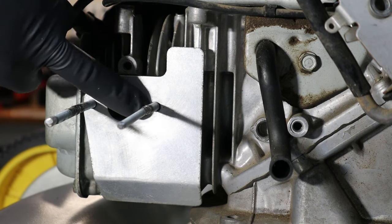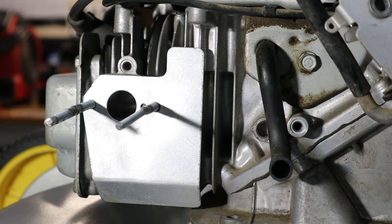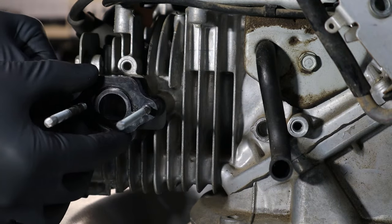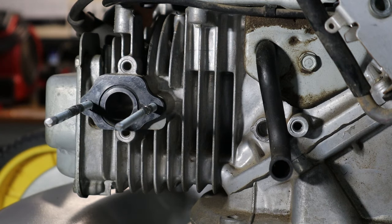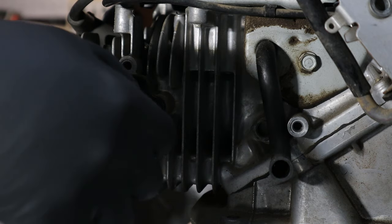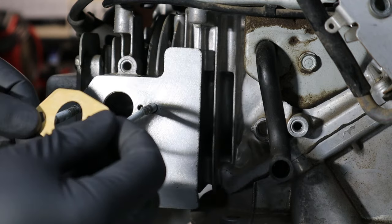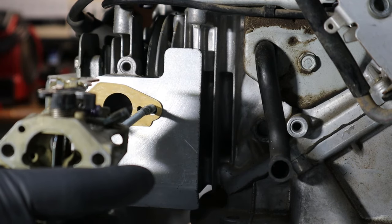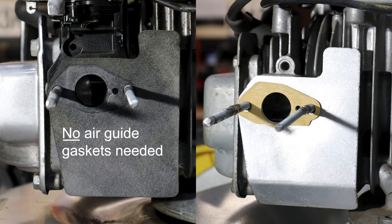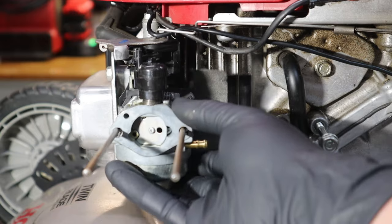On the flip side, if you have a metal air guide like the one seen here, you will need both air gaskets. If you have a metal air guide, you will need to take the air guide back off and I'll show you the order it goes in. Start with the insulator gasket, then the carburetor insulator itself — you'll notice on this one it doesn't have the auto choke, but it acts as the same function. Then add the first air gasket because we have a metal air guide, then install the metal air guide itself, followed by the second air guide gasket, and finally the carburetor assembly. If you have a soft air guide, that is your gasket — no additional gaskets needed. If you have a metal air guide, you will need both air gaskets.